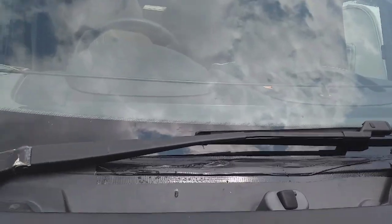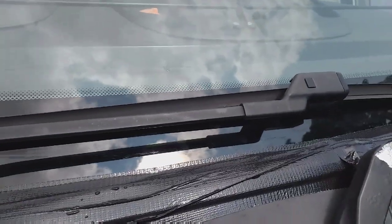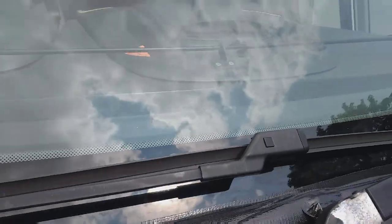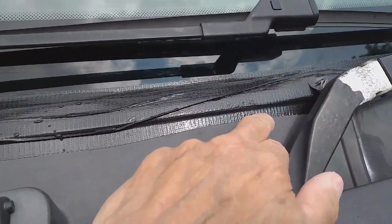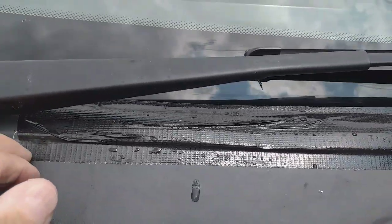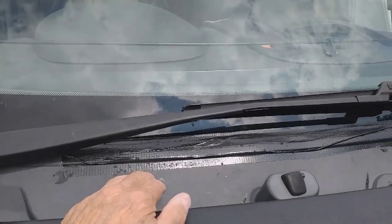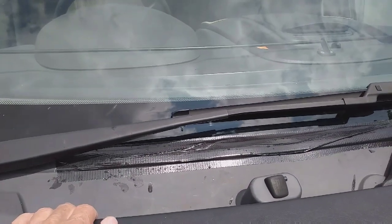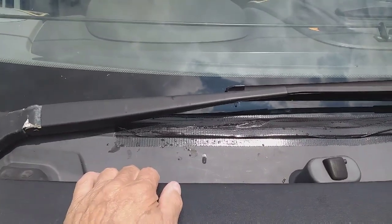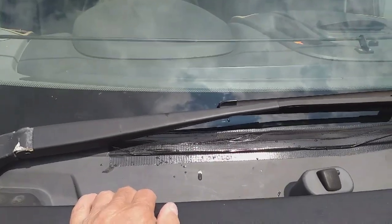Found the culprit — this seal here on the windscreen. I poured water down the windscreen instead of in the trough and water just poured all down the engine. This seal here is not keeping water out. I've taped it up here and tried it — put water down the windscreen and nothing went on the engine. There it is, that's the culprit. Cal at Roaming in Raymond — what's going on Cal? Why is that leaking? Is it supposed to leak? Has the windscreen not been fitted right? What is it? Maybe you can tell me, Carl. See you later.